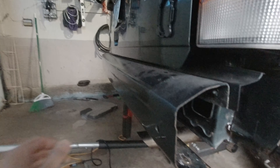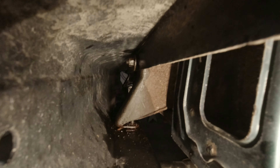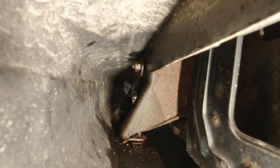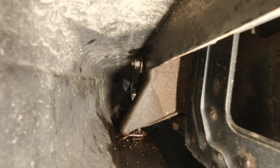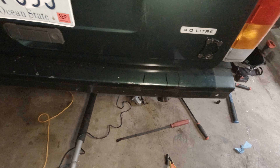I'm currently working from home for those who don't know, so I'm taking breaks here and there. I got it pretty much a little out, but the head of the ratchet keeps getting caught and it appears that the bolt is already starting to kind of strip. I don't want it to get worse. So what I'm going to do — I'm not going to be using this bumper anyway, obviously I'm going to be getting a new one. So I kind of drew a line from that bolt straight up, and up here is where that bolt inside is. So I'm just going to cut a window so I could just put the socket in and crank them out. Same thing for that side.